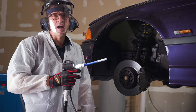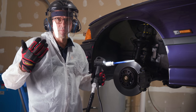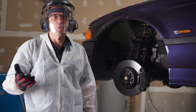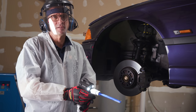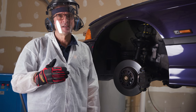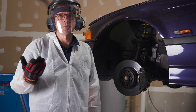I did turn my volume down quite a bit. Makes the process a little slower, but it's reducing the water, the moisture, or the ambient air issue that I have. You know, we brag about this all the time. Oh, it's a waterless process. Well, that's true. There's no water coming out of here, but we got to deal with ambient air temperature. And that's why in the ideal setting, you know, 70 degree, 30% humidity, air conditioned space would be great.